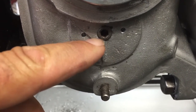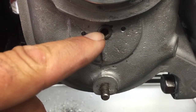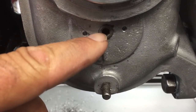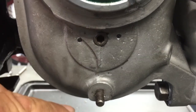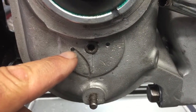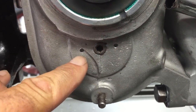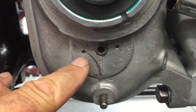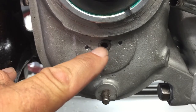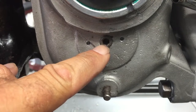So you're going to have to thread it for a little bit, get your plug, check how you screw it in, check how far it goes in. Not deep enough — tap it a little bit more. But the last thing you want to do is go too deep on this one. Afterwards, you can just get some two-part epoxy and fill up these two punch holes, and you're good to go. You won't have any oil leaks. This plug here is an upgrade that we came out with a while ago, and that way we don't get any chance of any oil leak.